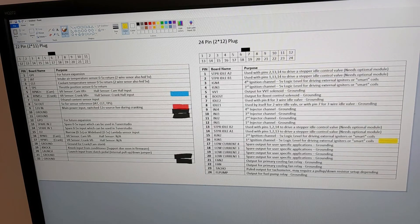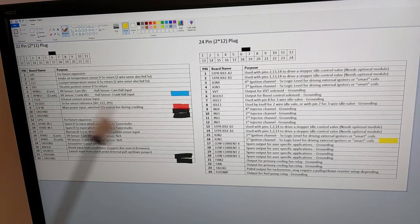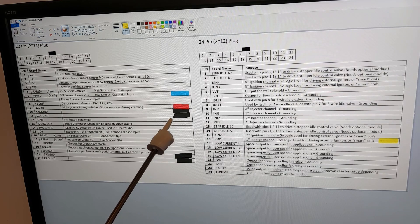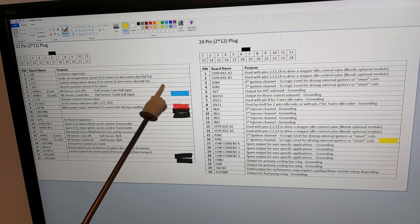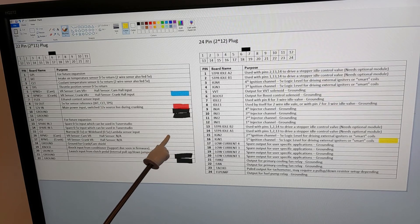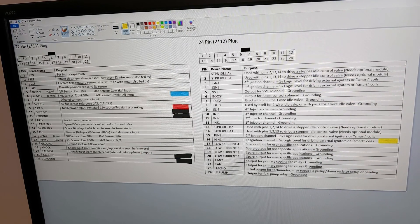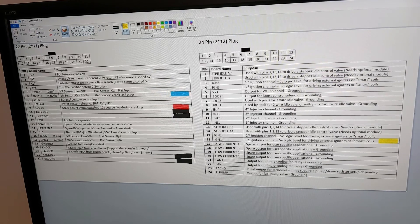Here is the wiring plan for this car. The ones with colours against them are the wires I'll be using today - really, really simple. There are only four different wires to be used, although the ground is sort of four wires in itself. So we've got ground cables in black - four of those in total - 12 volt in, the crank sensor input. I'm going to be using a Hall Effect sensor, so you only need the one. If you were going with a VR sensor, you'd need the corresponding negative to go with that. And the only output from the ECU is the ignition output, which I'll be using to drive a coil driver using the standard coil and distributor setup.